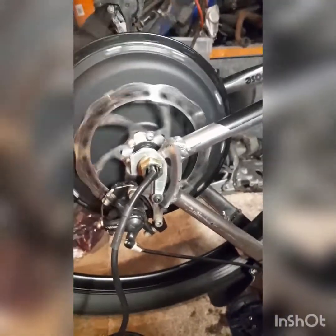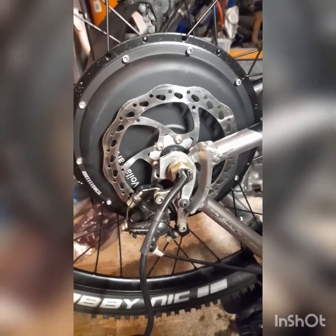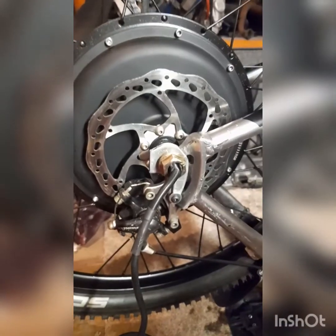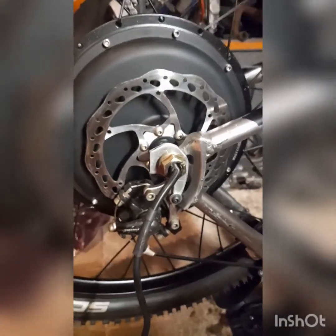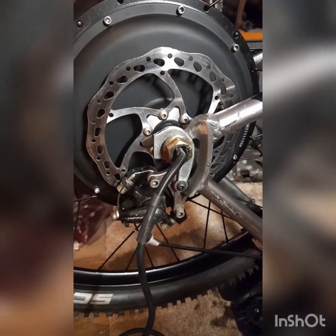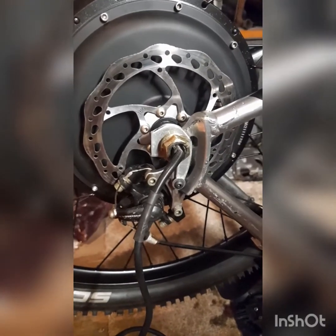One torque arm done — I can't see that axle going anywhere. You can make these as tidy as you like; I've just taken all the rough edges off, but you can paint them or do what you like. It sits nice against there, that edge plus you've got your washer sitting against it, so that whole axle is now sat against the back of the frame. I'll do the same on the other side, and then in the video I'll show you how to wire the controller up. These Voilamart kits are normally pretty much plug and play, so let's hope it's the same.